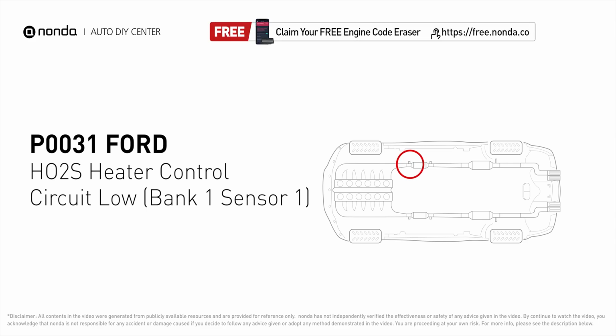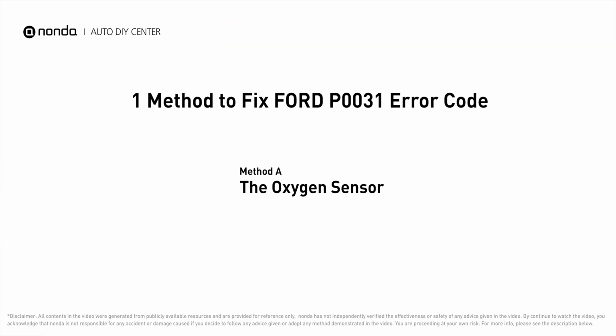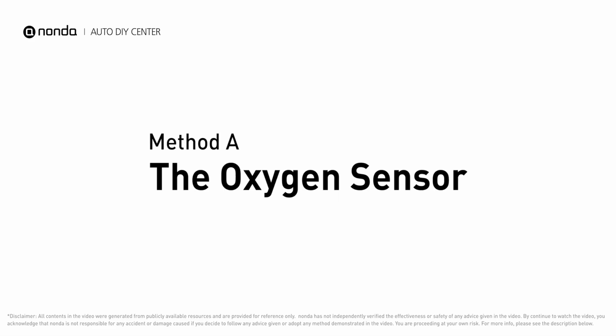This code may be triggered when your vehicle's control module detects a fault in the heater circuit and oxygen sensor bank 1 sensor 1. Here are one of the most practical solutions to fix Ford's P0031 error code. Method A, the oxygen sensor.